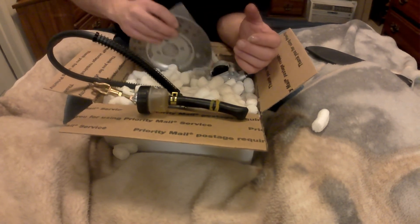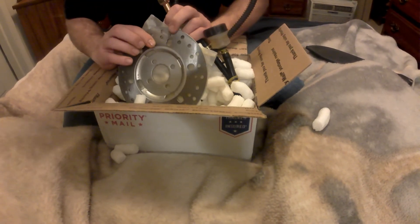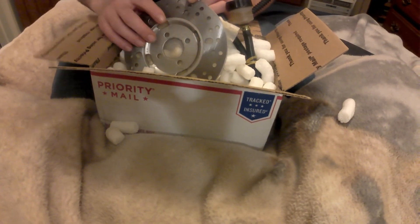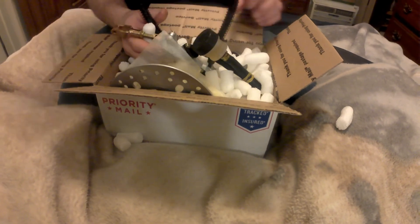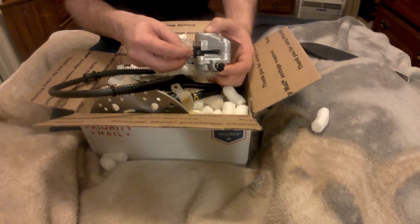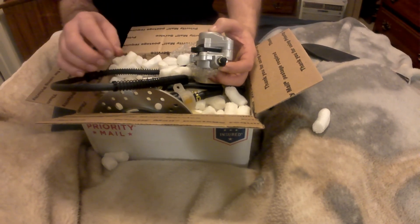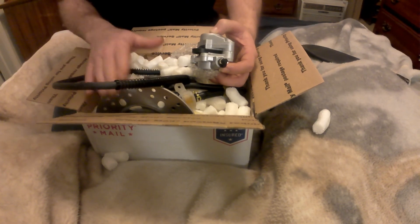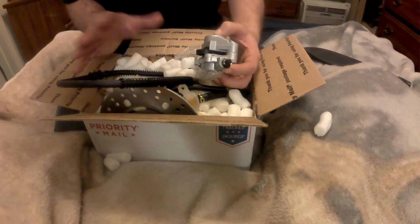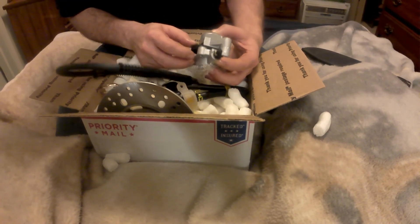The drilled rotor makes cooling a lot easier. The slotted ones don't only have holes — they also have slots all the way around, which also helps cool the brake rotor. When you put the brakes on, you're causing friction, and friction is what stops your vehicle — go-kart, mini bike, whatever. It needs a way of cooling. The ones with slots are better, but the ones with just holes, like this one, work pretty good too.